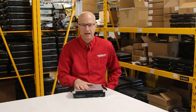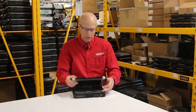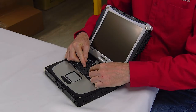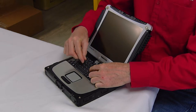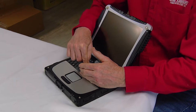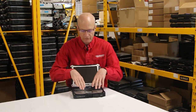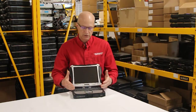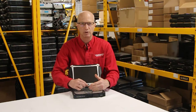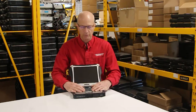Number 3 in my list of most annoying issues is how, when you go to replace the keyboard, the cabling underneath there tends to connect to a connector on the system board. If you don't carefully remove that cable, you will break that connector, and then you have to replace the system board. Other models actually had a replacement board that it plugged into, which was much more forgiving whenever you replace the keyboard.